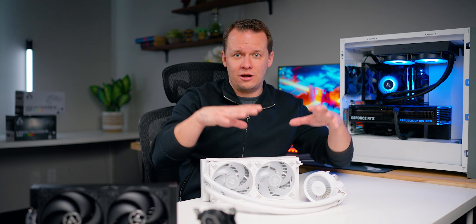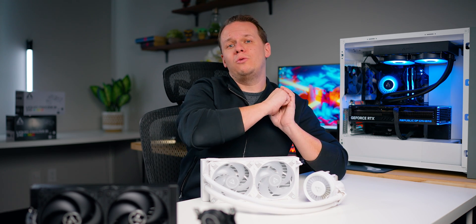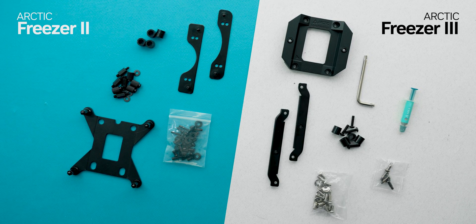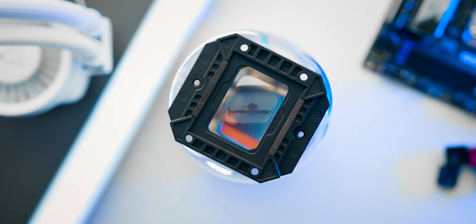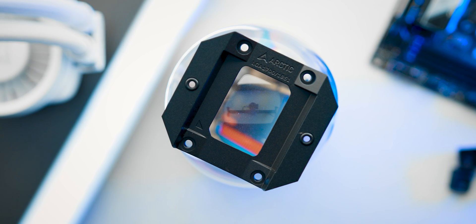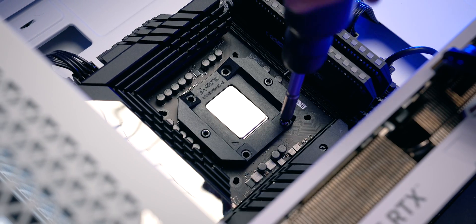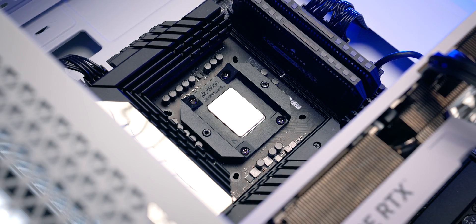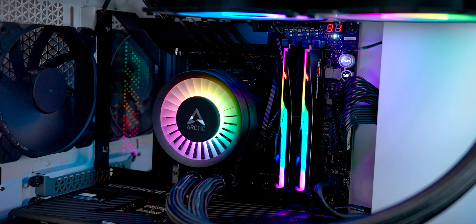When it comes to most aspects of the physical design, Arctic listened to feedback and improved things for the better. But to me, the biggest change is the mounting hardware — it has gone through an evolution of epic proportions. The Freezer 2's hardware compared to the Freezer 3's is infinitely simpler, and there are some very unique things like a contact frame for Intel CPUs. These have been available in the aftermarket for years, but this is the first time I'm seeing one included on a cooler. It replaces the stock ILM, and you'll need the included Torx head screwdriver to install it.